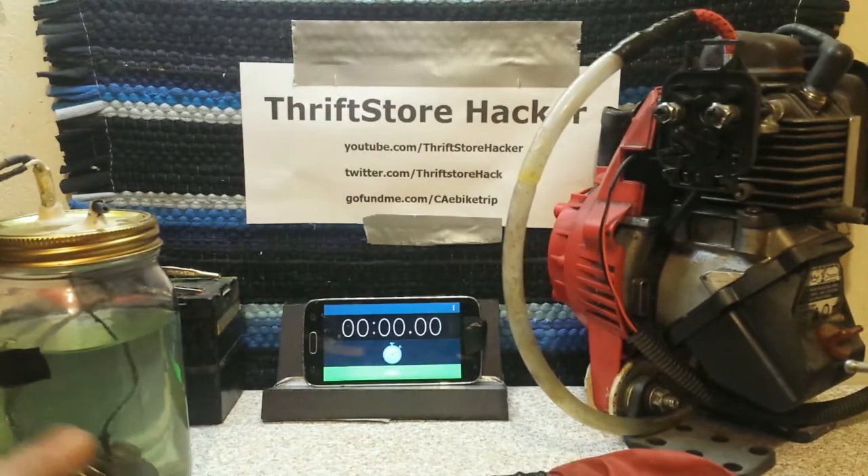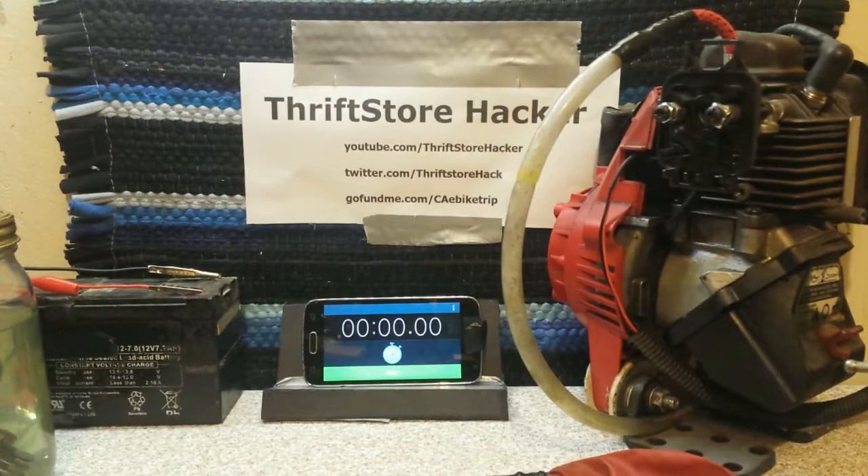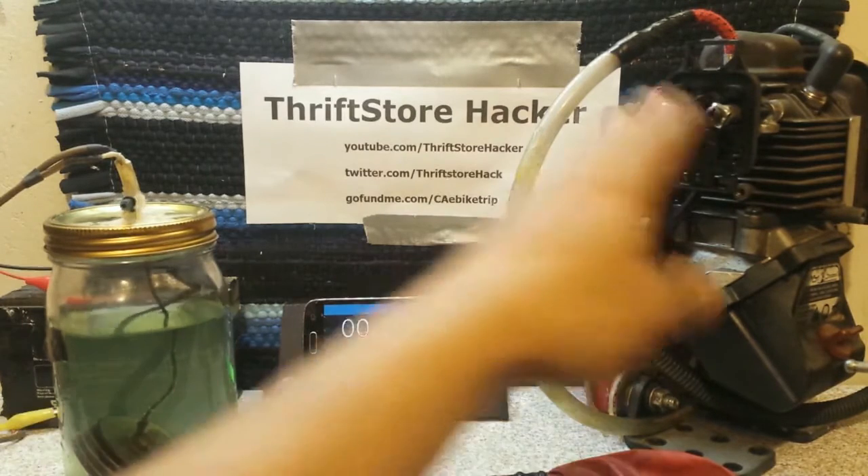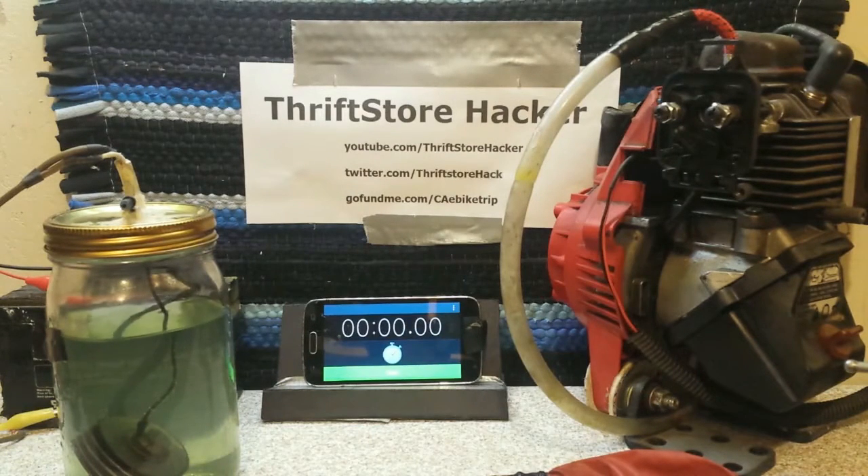What we're going to do is start off with our HHO generator, and I'll do a time lapse of the balloon filling up, and then we'll go over to the motor, put it on the motor, and let it drain all out into the motor, and measure exactly how long it'll run for. I already know with our cell here, we're not going to have enough volume to continuously run this motor, so maybe we can get a good base number on how many of these I need to build, or how much more efficient I need to make this one. Hopefully we can get this motor to start up.